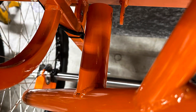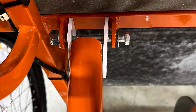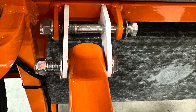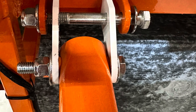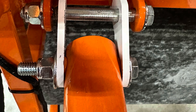Start by removing the front bolts. Install the lift brackets as shown, with the bolts through the original mount tabs on the body. You may need to slightly loosen the rear tabs to allow some movement. Then install the bolts through the lift brackets and the mount posts on the chassis. Tighten these down all the way. Do not over-tighten the bolts through the body's tabs — you don't want them to bend inwards.